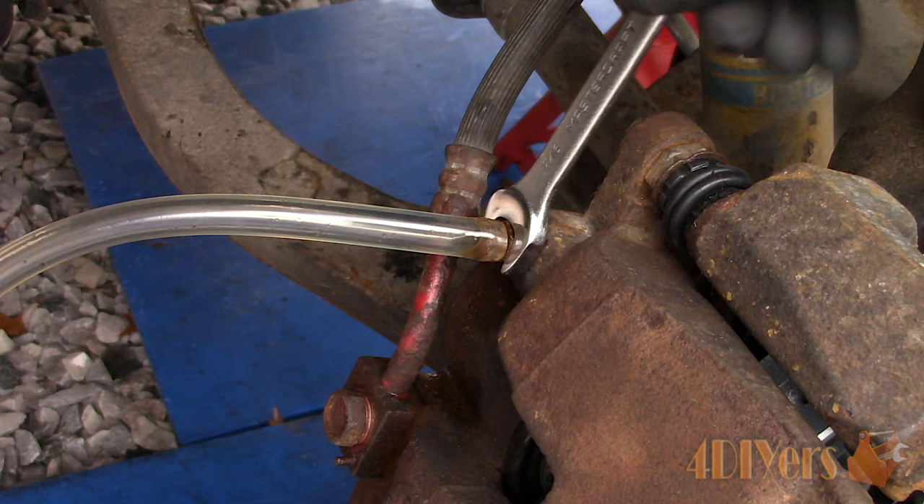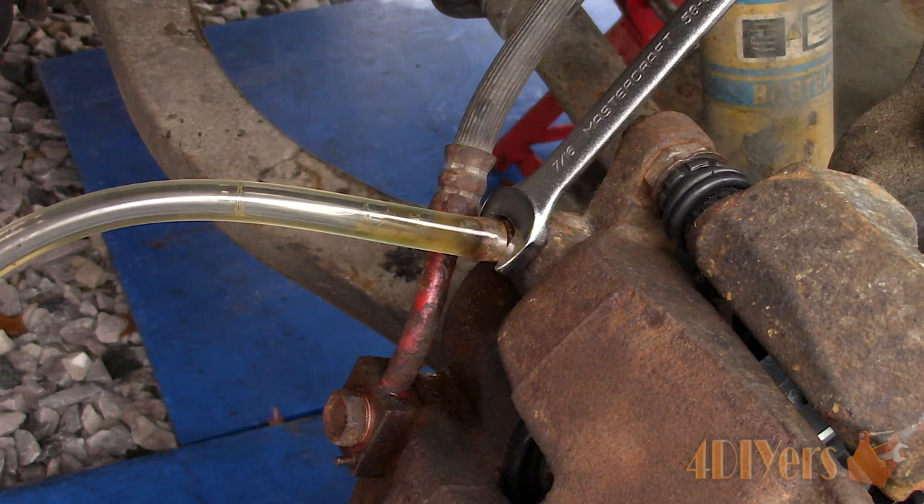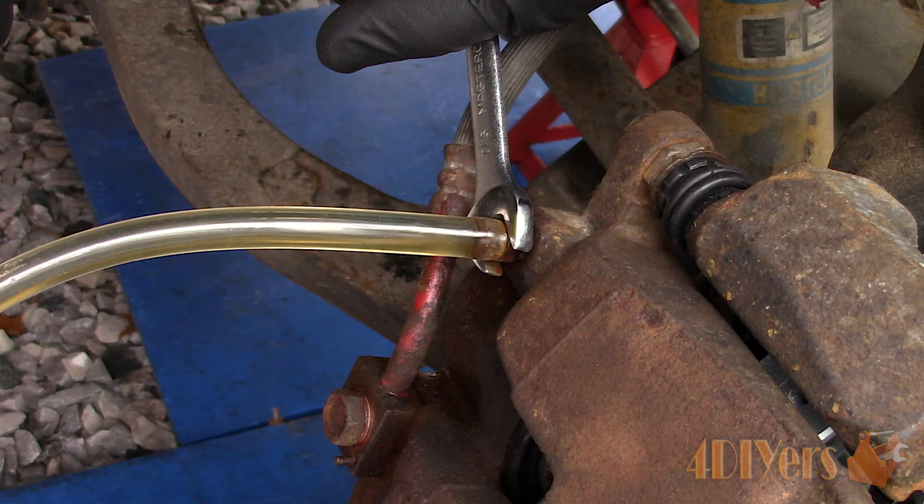When bleeding air in the system, you'll notice excessive bubbling in the fluid which is normal. The bubbling will change when the air is removed from the system, either by being greatly reduced or completely disappearing — this can be easily spotted with a clear hose. It's common for bleeder screws to leak around the threads when open, but as mentioned, as long as there is negative pressure at the bleeder, air cannot be pushed back into the system.